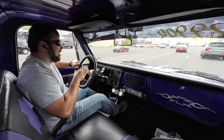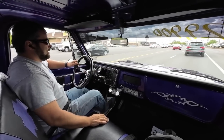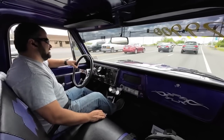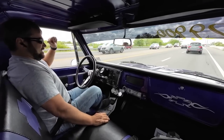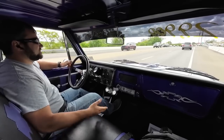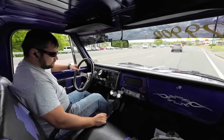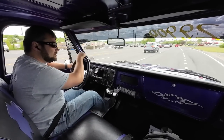When I first hit the brakes, I could feel they're grabbing a little bit more up here in the front right. See how it's pulling me there? As far as steering, it's going straight, tight steering there, throttle's great. The brakes, watch the steering wheel. See that? Pulling me over that way. They're stopping. I'm just grabbing a little bit. Engine temperature, oil pressure, all that's in good range there.